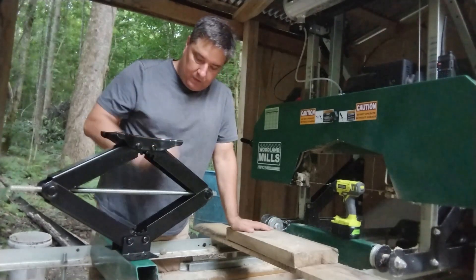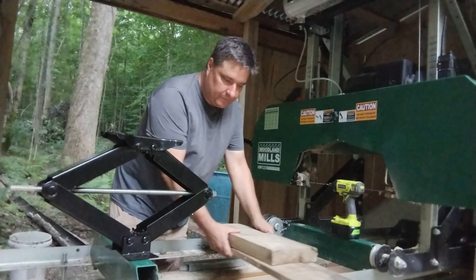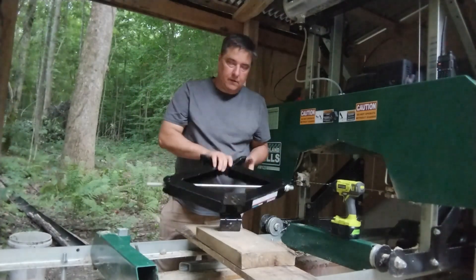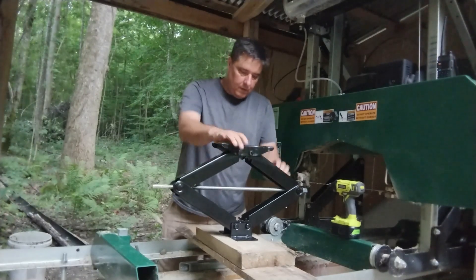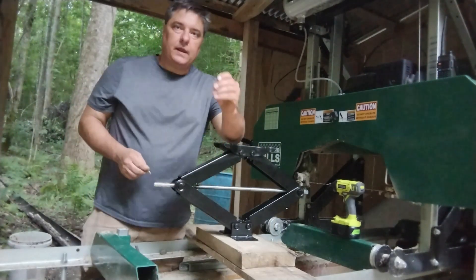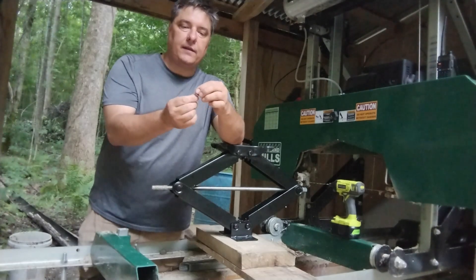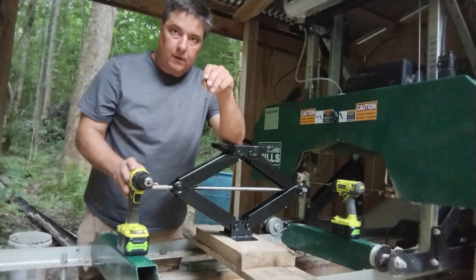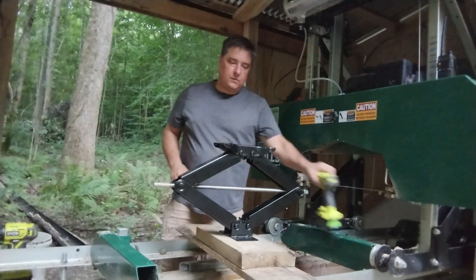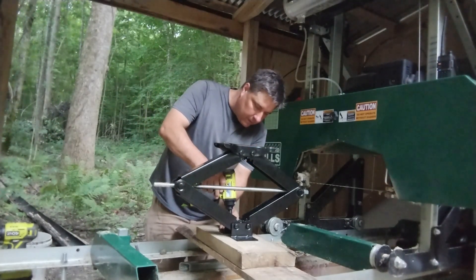This is the board that's going to bridge the two cinder blocks — we're going to mount it to that. I'm going to set it right on there. It has four holes on each side, and that's for mounting to the bottom side of an RV or camper. Those holes are a little bit big for wood screws, so to counter that I'm using this small nut here that's large enough to capture the head — it also accounts for that countersink. So we've got four of those we're going to put in on each side — should be pretty stable. I just need to line this up a little bit — it does not have to be perfect. And away we go.